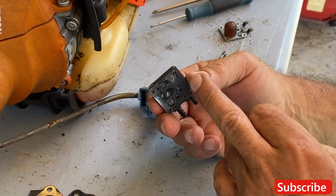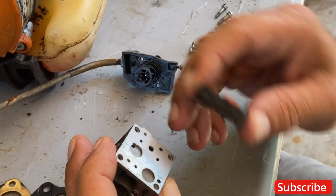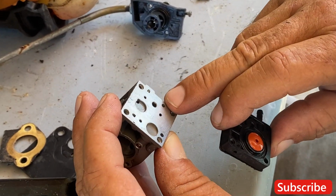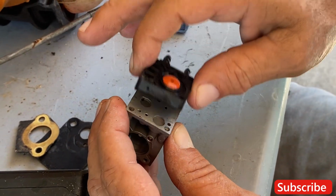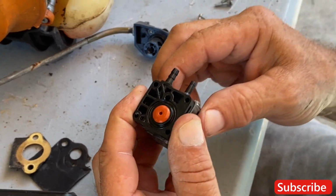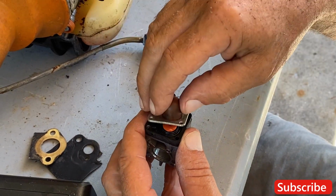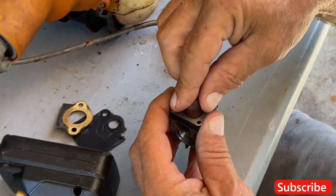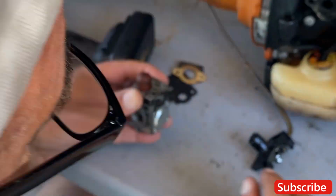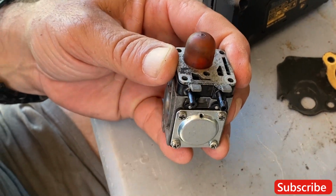Okay, so you got these two little pulls sticking out here and here. You line them up with this here and here. Sometimes you gotta move it around to find the right hole. Once you get it in there, it won't move around, it stays put. Then you come over, your primer ball, put that on. Make sure your protectors are protecting your intake and out.